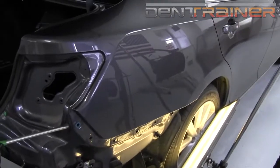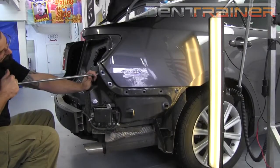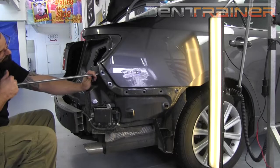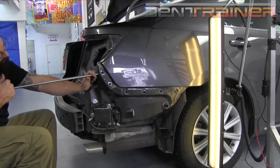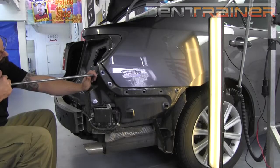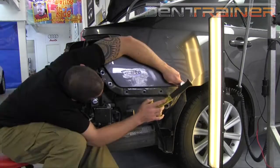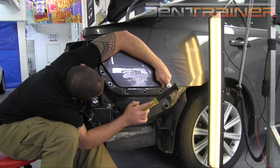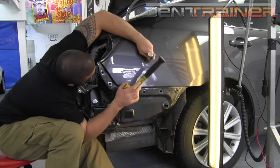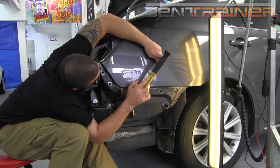That's definitely what we were looking for. I'm going to do a little bit more picking on the inside of this — right up there at the top of the line, I'm going to pick it clean just a little bit more. What we're doing is preparing this thing to actually wet sand the finish and do a little bit of buffing, kind of retexturing. It wasn't quite good enough yet to go in there and retexture the finish and expect it to be nice and clean, but we are dialing it in.